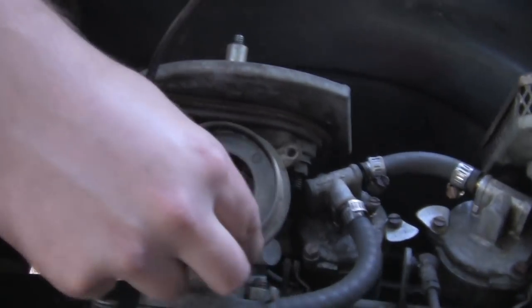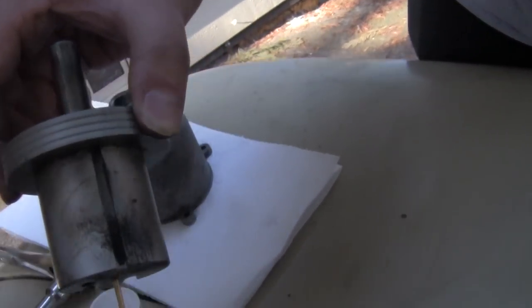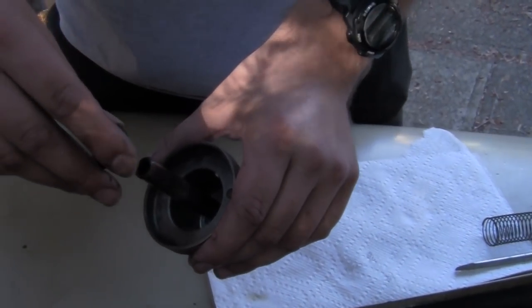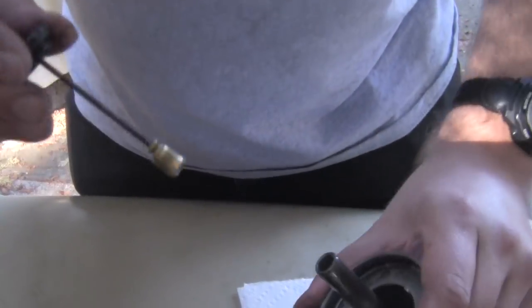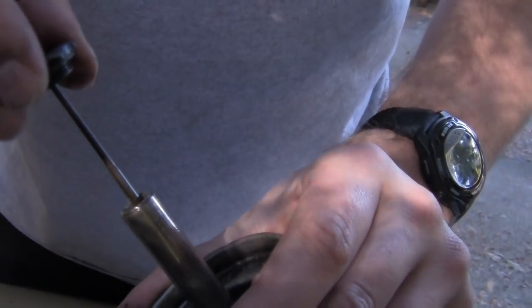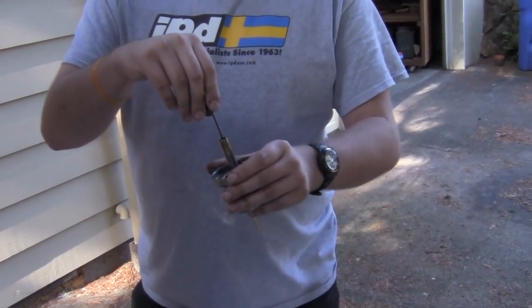Here is the all-important piston of the carburetor — you can see all this gunk here; that's bad. This is your carburetor needle, which determines the mixture. This will be full of whatever fluid you're using for the dashpot. It's got a little valve that opens and shuts — it's just like a shock absorber. When it pushes down there's resistance going down, then it pops out really easily. When you accelerate, you want the piston to lift up a little bit — that kind of takes the place of an accelerator pump on a more complicated carburetor. You want the dome to lift up but drop down again quickly.